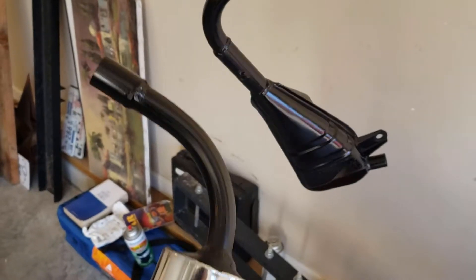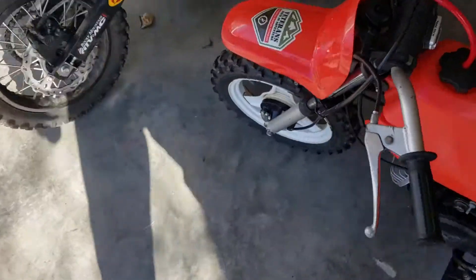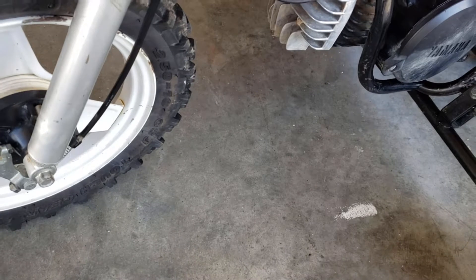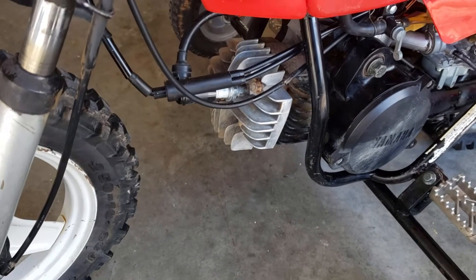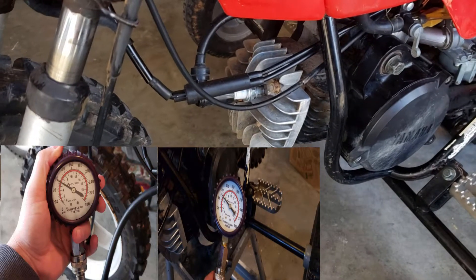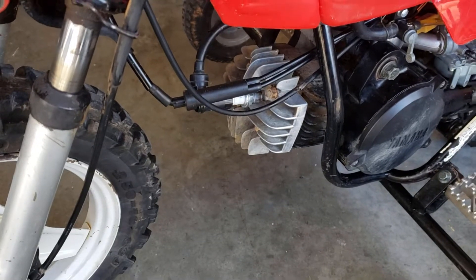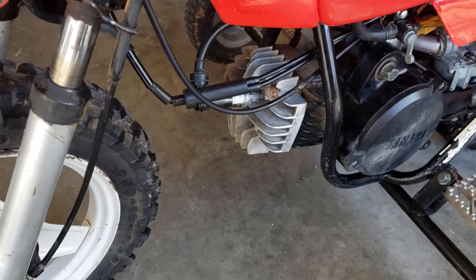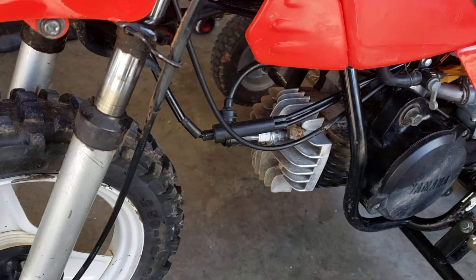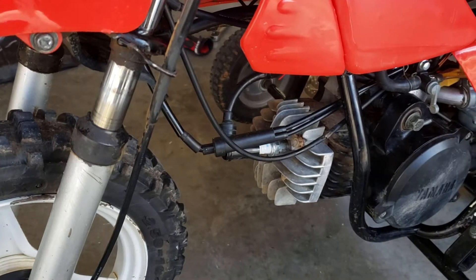We got the new fresh paint on there — this one really didn't need too much paint, so we just put it on that little spout right there. Looking back at the motor, underneath the piston looked like it was a little bit scored, and one of the bolts was really loose. I did a compression test: I had 90 when it was cold and probably about 70 when it was warmed up, so I'm kind of wondering if maybe it could just need new rings — but all in due time.